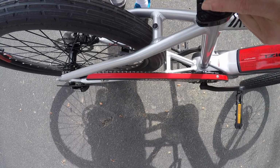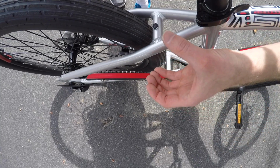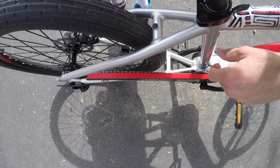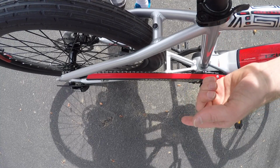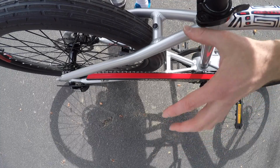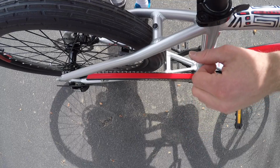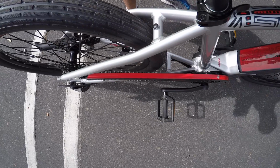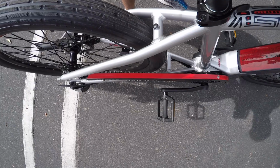And I did check, the seat post diameter is 29.8, which is kind of unique. So I think you could use shims, which are these little size adapters, and you could potentially get a seat post suspension for this, because the smallest diameter is 27.2, and that would really smooth things out if you're someone with a sensitive back and neck like me. It's always nice to have options like that. We'll be in the highest level of assist, and I switched to the high step model, which doesn't have the throttle installed, so this is all pedal assist.